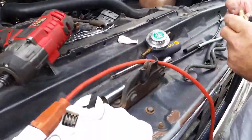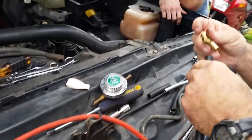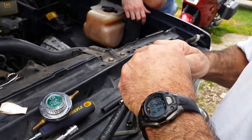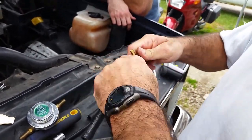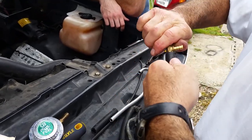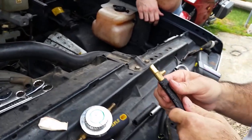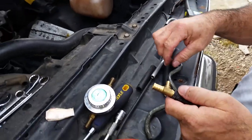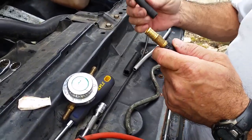We're back from the parts store. We went and bought some fittings and some hose, and what we're going to do is a little system we had on the big block wagon — we're going to run this fuel line into a T, and then off the little line we're going to run that back into the return with a restriction to give us our fuel pressure. That'll regulate our fuel pressure for us and it should work because it worked on the big block.